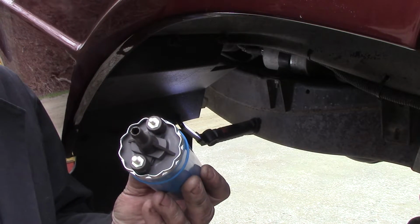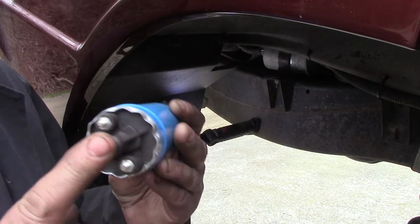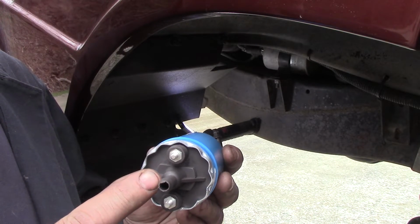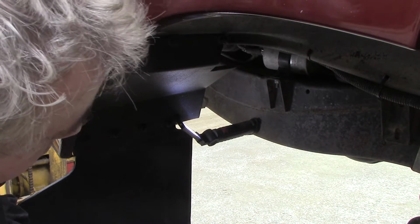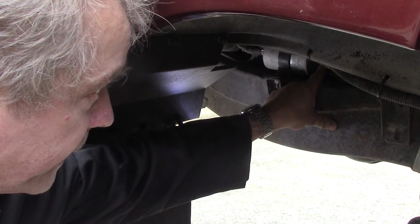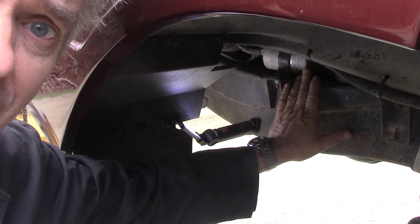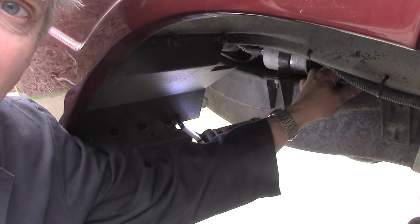Now this is only a temporary thing, because if this works and we get fuel to the engine and get fuel pressure, I shall buy a proper Delphi pump, which is $150, but with screw fittings on here and at the end that are the same. So my intention is today, there's the filter, and I want to take that pipe off there. So we're going to suck through that filter. That's why I never bother putting a strainer on, and it's huge. Look at it compared to my hand. So we're going to take that pipe off and then join it onto this one here.